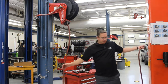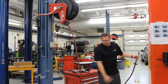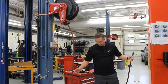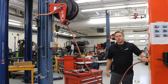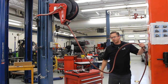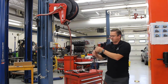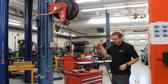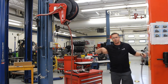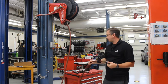You're going to take out enough air hose so that you can go to the furthest point you need to work on and the air hose lays across the floor — that way nobody trips on it. If the air hose is pulled up like this, it's going to block people's way and create a trip hazard. You're also going to get all the kinks and twists out of it so that it lays flat on the floor.